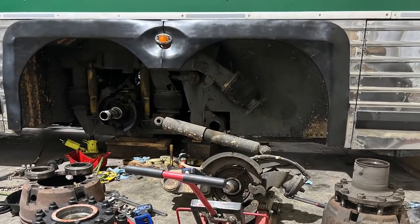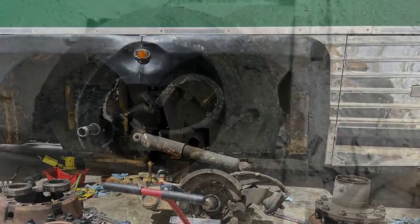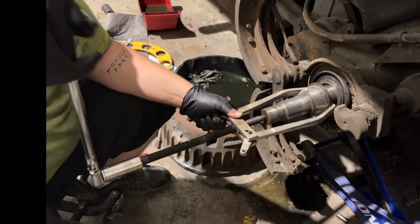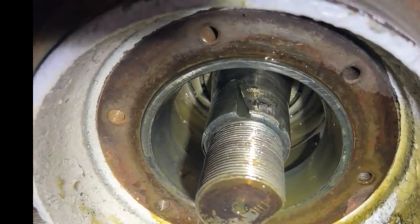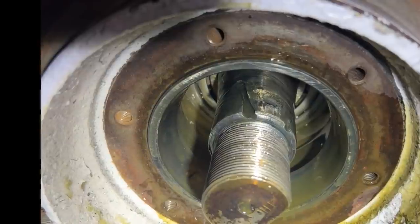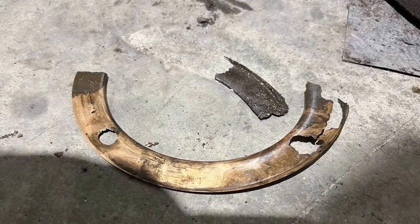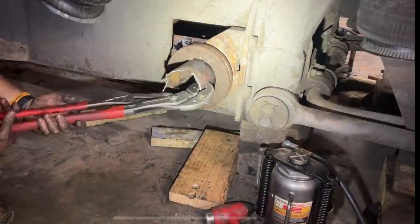Well, that was a long hard day — about six and a half hours of labor, just to give you an idea. We pulled two of those tag axle swing arms, cleaned parts, removed the bushings on one side. That bushing was very difficult — not a fun job. That seized wheel bearing on the side that was this bad — we're actually replacing the whole swing arm. Our friend Brandon at Cardinal Coach out of North Carolina is selling us a whole new swing arm, so we'll have a new spindle and everything, just to replace it. Only a few hundred dollars, so it was a no-brainer. The axle surgeon if we had them come out was going to be over a thousand dollars, so this by far was the smartest choice. But again, it was a hard day's work — removing both of those, getting everything done, fighting things not coming apart, stupid things welded that shouldn't have been welded. It was a non-stop battle with things that were stuck today but we got through it all.